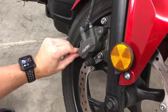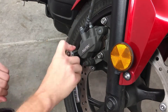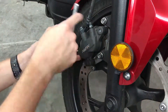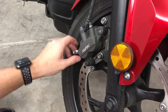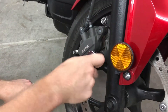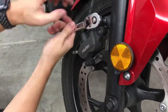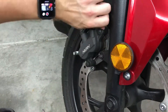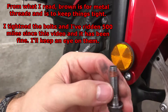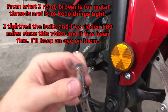Start off by removing the retaining bolt — I believe that's the proper word for it. It might be best to get these two bolts off first, then get this one that's holding the pads themselves. This appears to be Threadlocker Brown, which I'm not familiar with on the scale of Threadlockers, but I believe that's for non-removable. I got blue, so hopefully that's okay. We'll see how it goes.